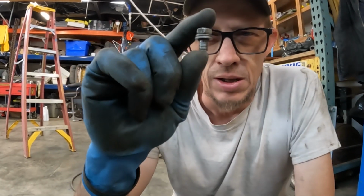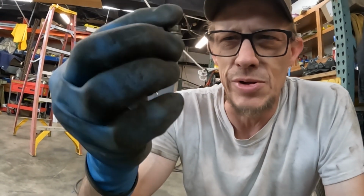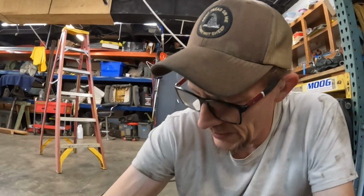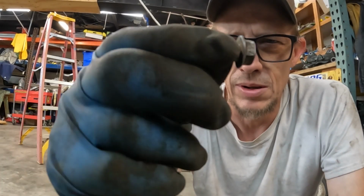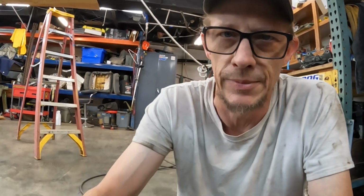Anyway, I pull it out, get to inspecting. The bolt that holds on the plate is too long. There's too much sticking up, like this double washer thing, and it was pinching into the back of the flywheel. So instead of those bolts, I'm going to use these incorporated flanges, and I think that should fix the problem. So let's try this again.